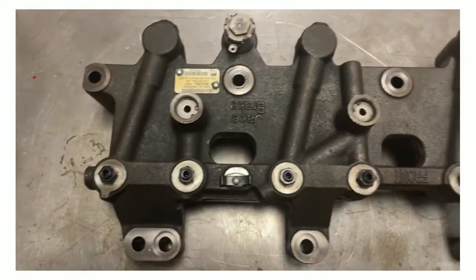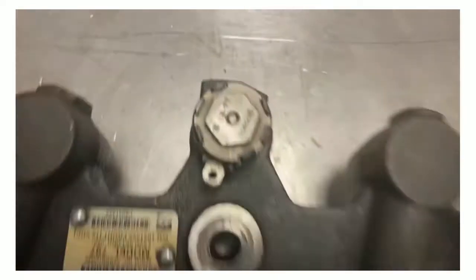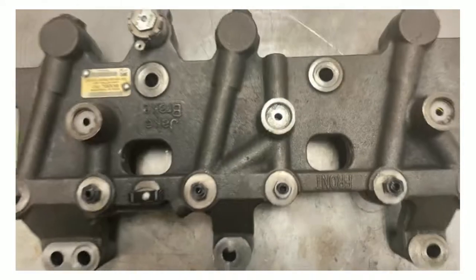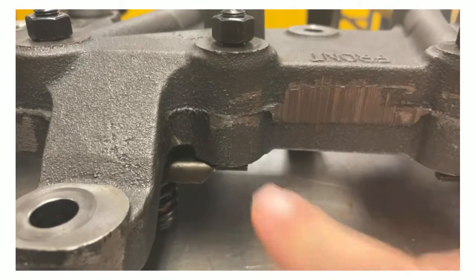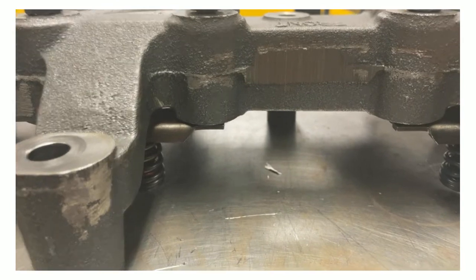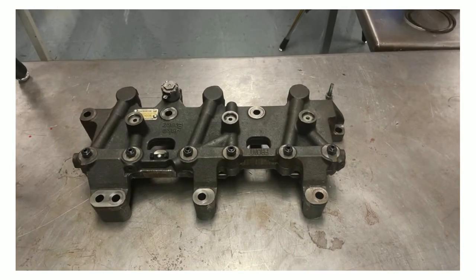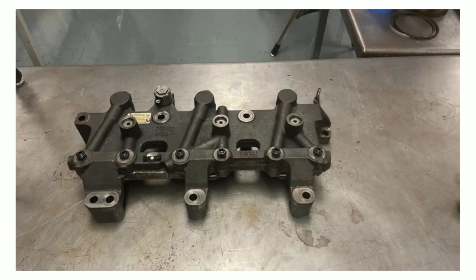This whole setup sits right over the top of your rocker arms and injectors, and it uses an electrical solenoid to allow oil flow to get into the housing. It then uses master pistons to increase the oil pressure inside the housing. That increased oil pressure causes the slave pistons to push down on the exhaust valve, and it's all timed to happen when the engine is nearing top dead center of the compression stroke. So the engine has all that effort going into it to absorb thousands of PSI of compressed air, only to pop open the exhaust valve and release that compressed air at the top of the compression stroke — hence no power stroke.